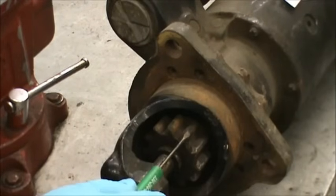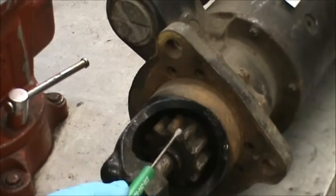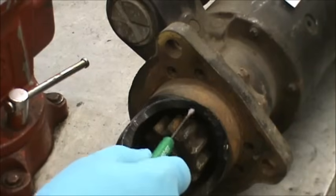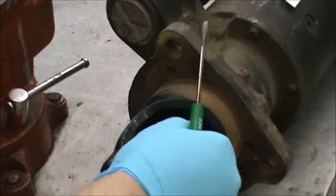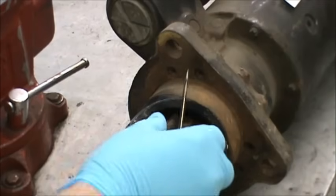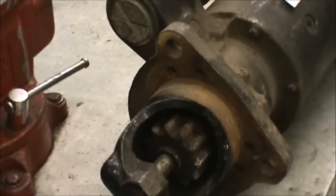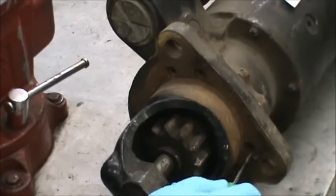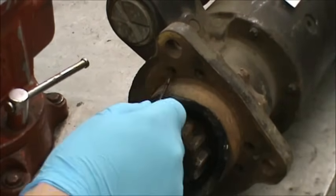This unit is equipped with the 11-tooth, most popular drive Bendix — Positork Bendix. If you put a paint mark on it you can count and spin it: 11 teeth, which is the most popular one for Detroit and Cummins. You can also run into some 12-tooth versions.